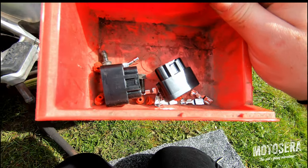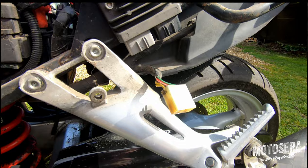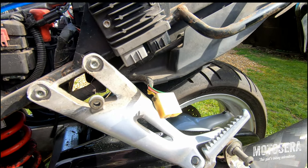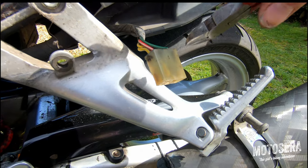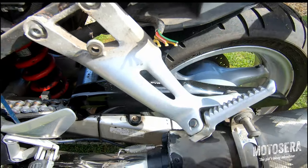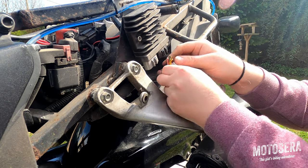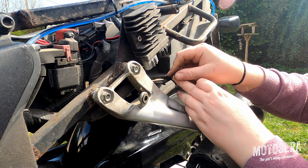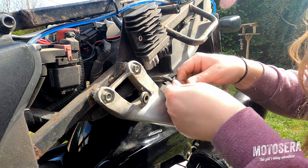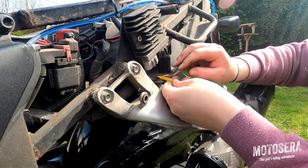The next thing we need to do is fit the new connectors to the existing wiring loom. We've already disconnected the battery. The reason we disconnected it is the red and white is connected directly back to it, and I'm about to cut through it. If I hadn't disconnected the battery and it touched any metal components it would short out and blow the fuse on the bike. So let's cut off the original connector. Now we have our bare wires. I'm just going to strip some of the insulation back so that we can terminate the cables well — just taking a knife and very carefully slicing through without damaging the cables underneath.